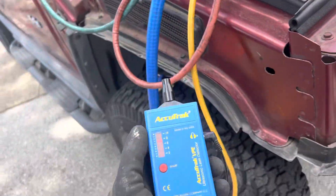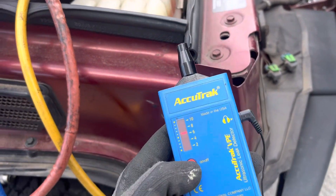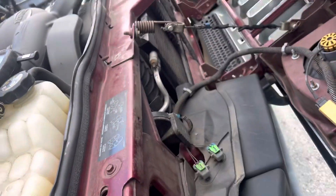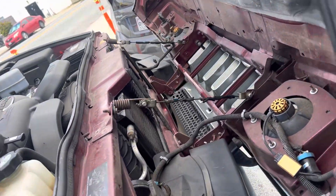So I'm going to purge the nitrogen out of here, throw some refrigerant in to test out the expansion valve, test out the compressor. But it's a Chevy, so the condenser is supposed to leak. I was first looking for the leak in the upper driver's side corner, because they usually leak on those.